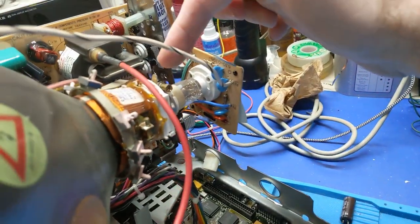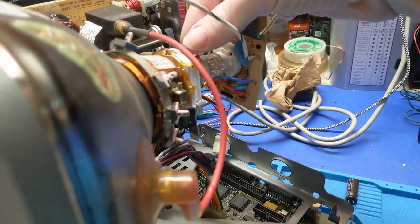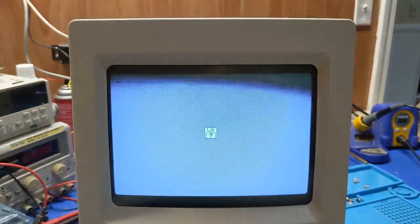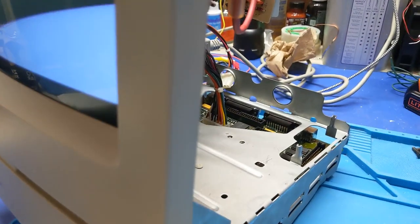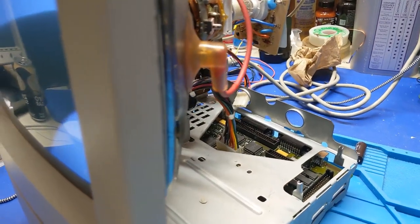Motherboard's installed. The only thing left to do now is plug in the power adapter and see what happens. It's either going to work or blow up. Hey, we've got a chime! Yay — there's another one fixed. Luckily, that one was fairly straightforward. The width is a little off — might have to adjust that a little bit, but that's not a big deal. Back here next to the flyback lead — don't put your finger in the flyback lead — there are centering rings right here which look a little loose.